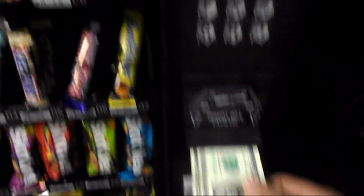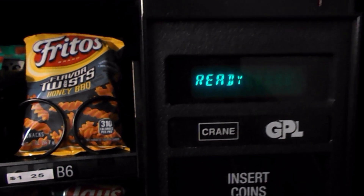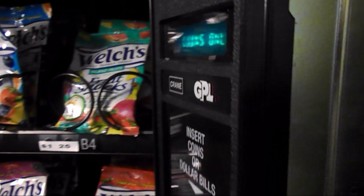Let's see what kind of error we got. We have no errors. It'll come up with an error if we enter it enough times. It was blinking five times. So it's blinking five times — that means the optical sensors aren't doing their job. So that means we need a new bill acceptor. We'll move on to that. This is really annoying. Now we have to order a new bill acceptor after already ordering parts for that bill acceptor.